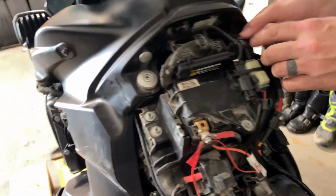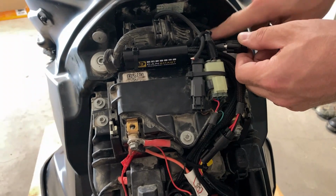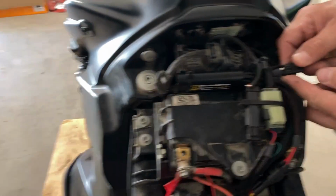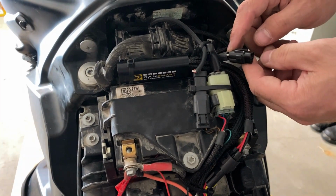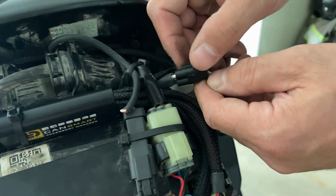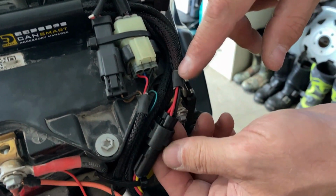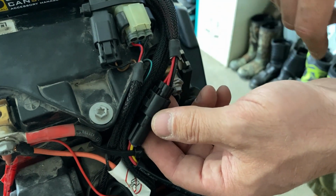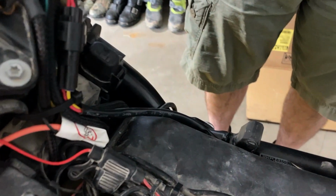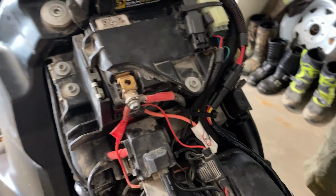As I said, there are different harnesses or circuits coming off of this. Each one of them has a color assigned. Like this one is the white or gray, and you can plug in harnesses going to other accessories with this. I only end up using one, which is this red one. You can see the red wiring here, and this goes out to my control harness that goes out to the lights in the front.